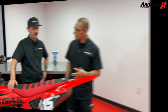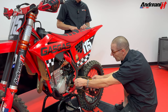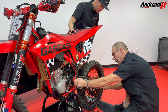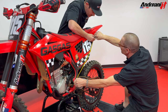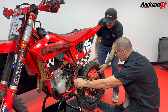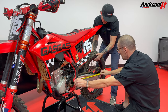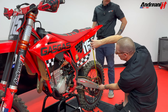I'm going to show you my way how I do the sag. I'm going to take the middle of the axle of the swing arm and the middle of the axle of the rear wheel, and just turn the tape measure and make a mark. The reason I do it this way is because the wheel works in an arc — not vertical, but in that direction.